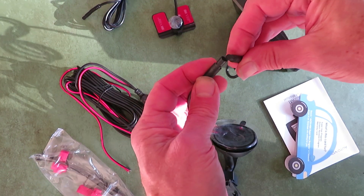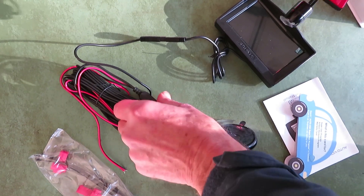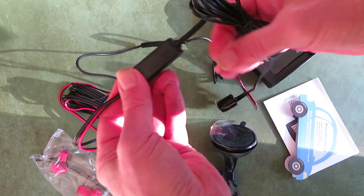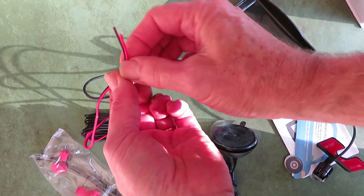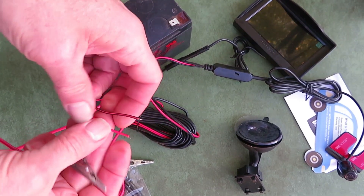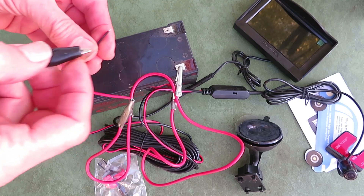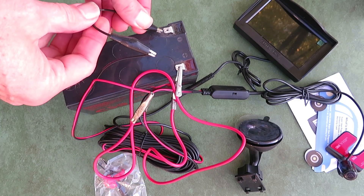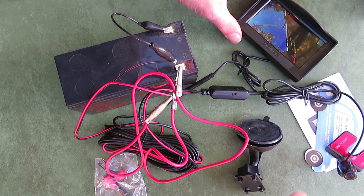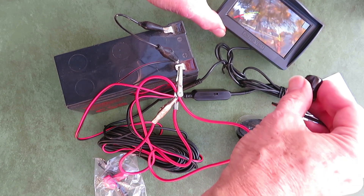Let's see what kind of quality we have on the video. The camera and monitor are getting hooked up to one end of the harness. The other end has this little box on it, which has a switch where you can turn off the grid lines. Here are the power lines. I'm going to put this on a little 12-volt DC battery, just using a jumper. The red lead goes to plus 12, the black lead goes to minus. And the video quality on this is really quite good — good color.